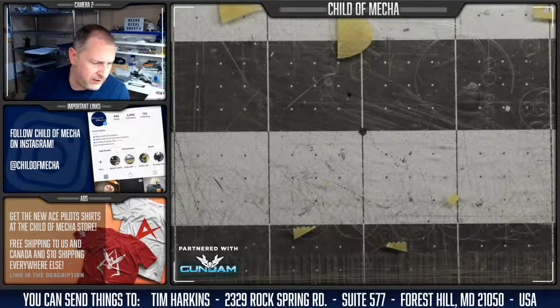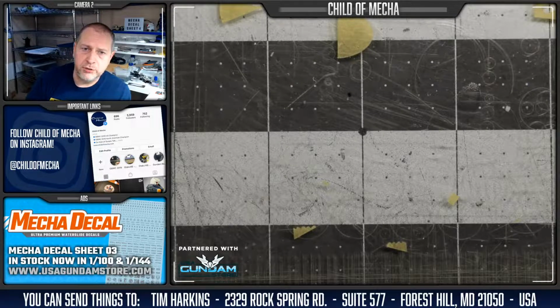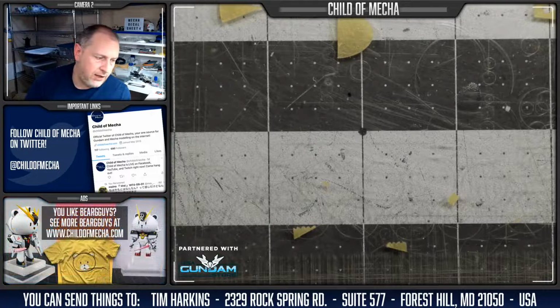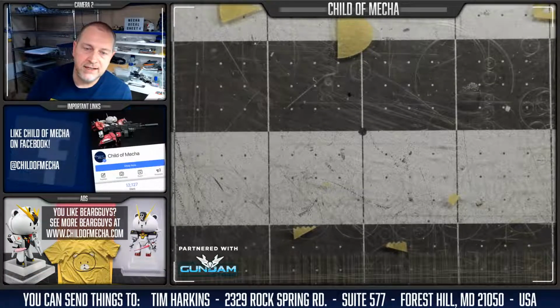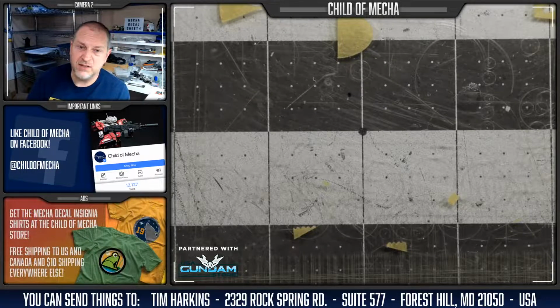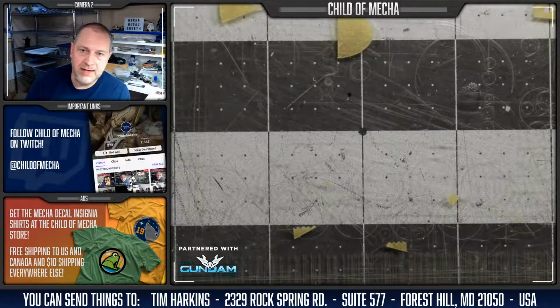But no, I mean, like I said, dust is a cat and mouse game. Chances are it won't be an issue, especially with a lacquer style of primer and paint. But there's always those times, right? And if you do happen to get dust in your primer, not a big deal because it's the base coat. Sand it down with a high grit sandpaper down to smooth, reprime.